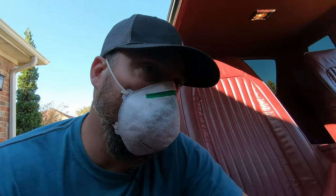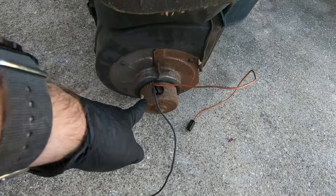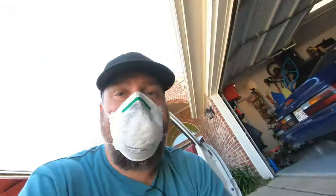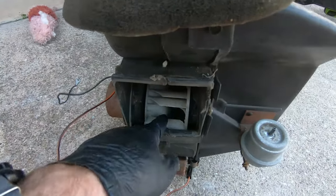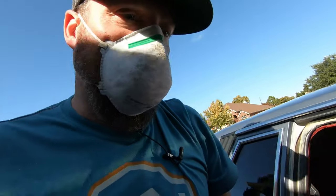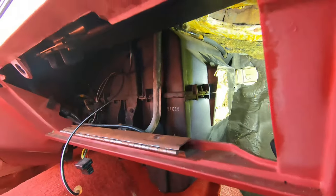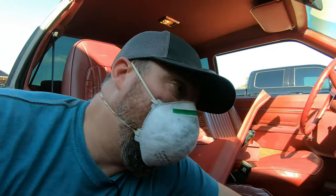It's just two bolts guys — one here and one on that bracket right there. Unplug the vacuum diaphragm, undo the ground, and now the blower motor comes out. You can now replace the blower motor itself if yours is bad, or in my case the impeller wheel is so busted up that it's not going to blow any air. Luckily LMR sells a metal replacement wheel, or you can go to a junkyard and get a new OE plastic one, which is what I'm going to do. You can see inside just how much nest material there is in the box.